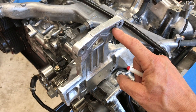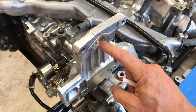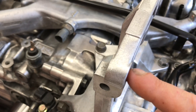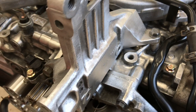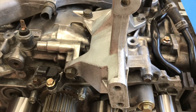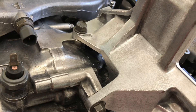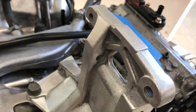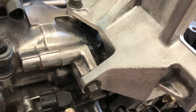This sucker right here is actually the AC bracket. I'm actually going to remove my air conditioning, but I'm still going to use this bracket because it's got a really nice hook point right here, which is perfect when you're removing and installing your engine. I started cleaning it with hot soapy water, then used a little mag wheel cleaner to remove the oxidation on the aluminum surface. After rinsing, I actually take a brass wire wheel with my drill and just clean this sucker up.